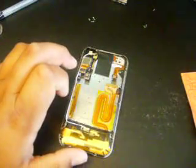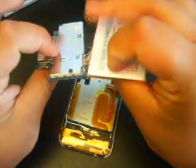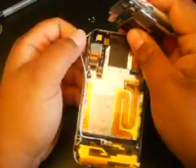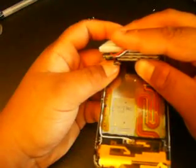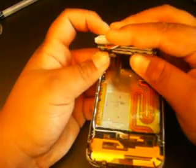First, you're going to grab your motherboard and your battery, which is together. This is how I do it — I'm just going to show you guys the easiest way I think it is. Got the antenna cover, the antenna piece — flip it behind. Now you're going to have to put the motherboard back on. You just turn it like this, and then you snap it from left, snap all the tabs on from left to right.